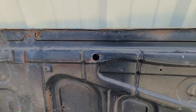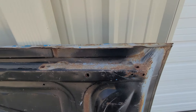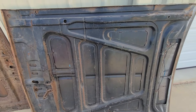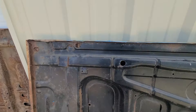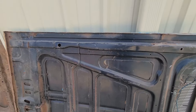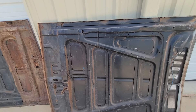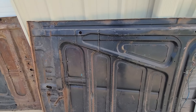Now this one — notice it has the crinkle zones but it does not have the rectangles. They're not there. This is a flat hood, and this hood would be a 1972 to 1974. So if there are no rectangles in your hood, that means your hood is a 1972 to 1974 — and that goes all the way across from shaker hood to rally hood to flat hood.